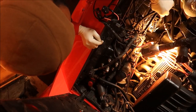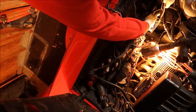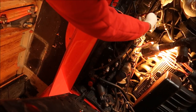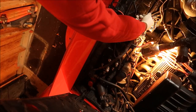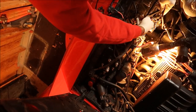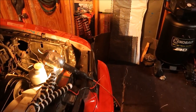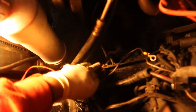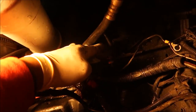The ground wire coming from the motor — I measured it and I'm going to drill a hole in the frame right here and mount that to the frame, leaving enough wire. I'm going to cut the wire here so I can reuse my terminal on the inside when I mount the battery. I drilled a hole right here in the frame rail and ran the ground from the motor to the frame rail — it's bolted in. Make sure anywhere you ground anything, you strip the metal down so that it's bare metal touching bare metal.